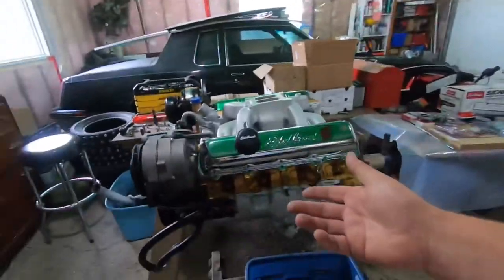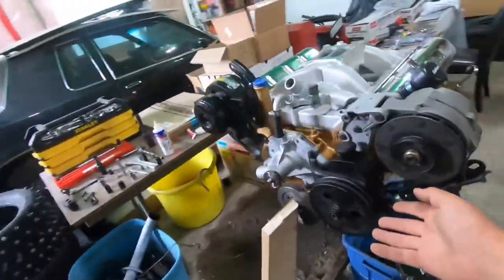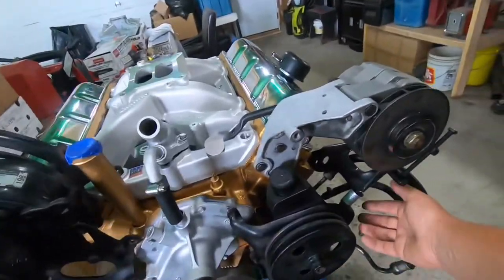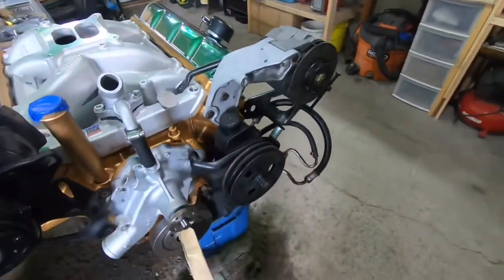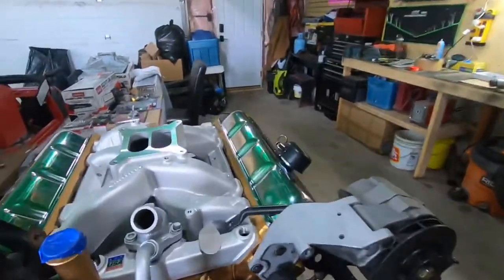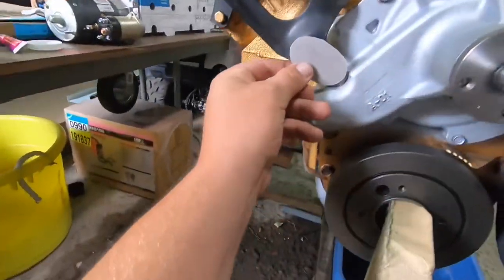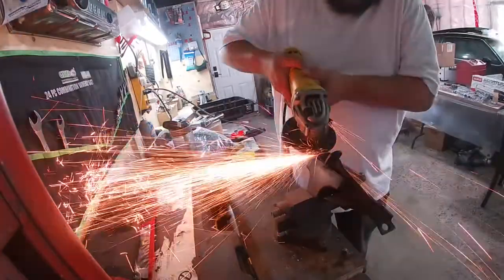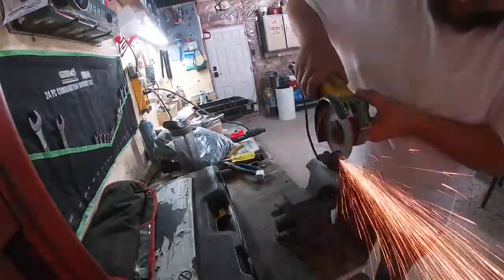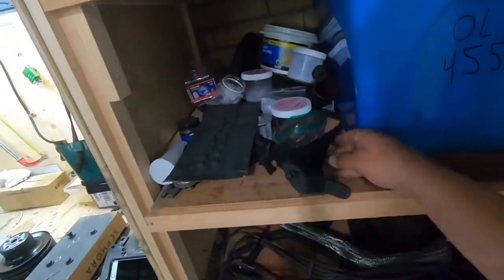For our alternator and power steering, it's actually really simple - they just hook up. They require an inch and a half spacer between here. Believe me, I talked to guys online and got a different answer from every guy - one inch, inch and a quarter - listen, that's an inch and a half spacer. I was just using some scraps around to mock up these tabs that I'm going to make, then I'll cut those out of some steel - probably out of these old 455 brackets since it's made out of the same metal.